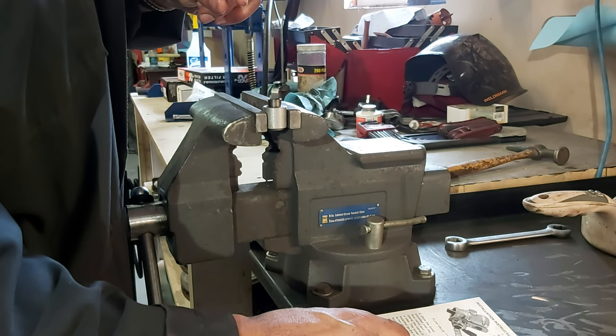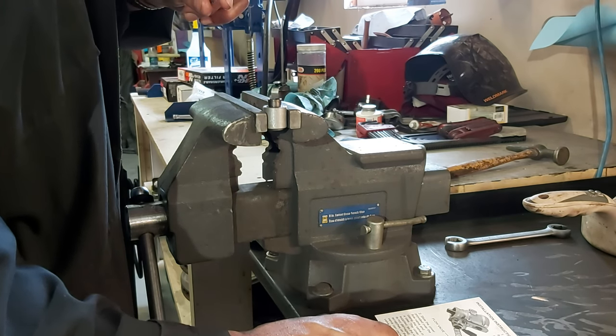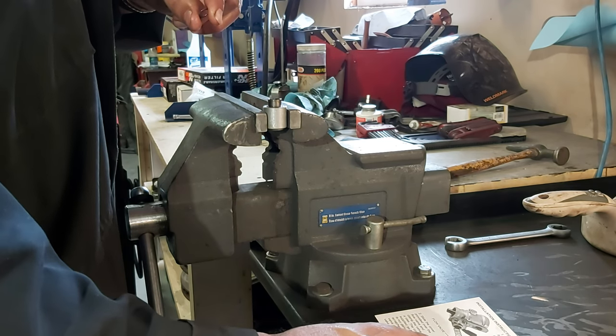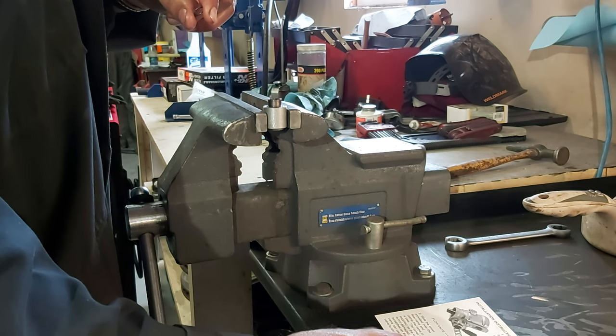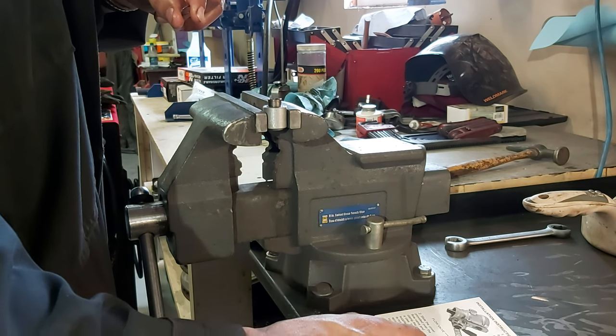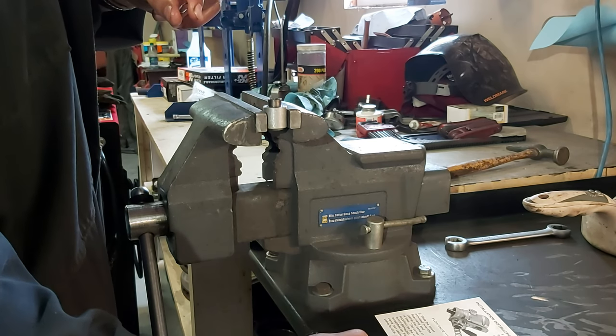The chart says three shims. The following chart is for reference only — different pumps may vary pressures. Mustang rack and pinions generally require approximately a thousand PSI. No shims: 1,350. One shim: 1,200 — so that's what our GM gearbox is working at. Two shims: 1,100. Three shims: 1,000 PSI.